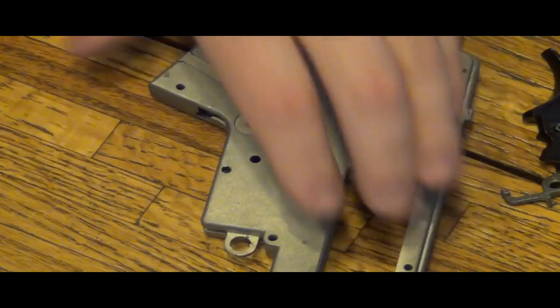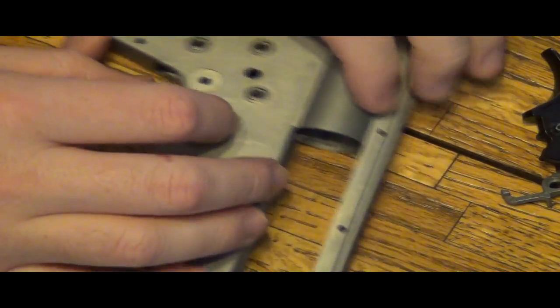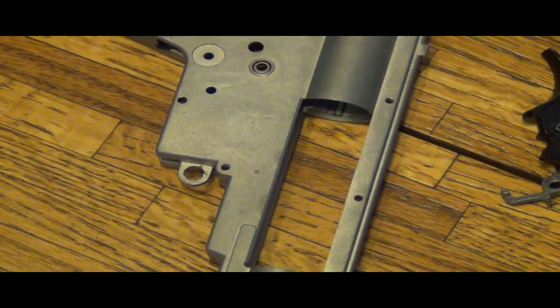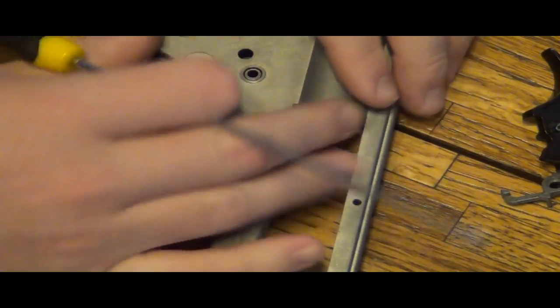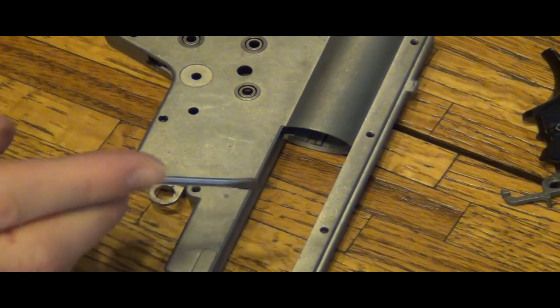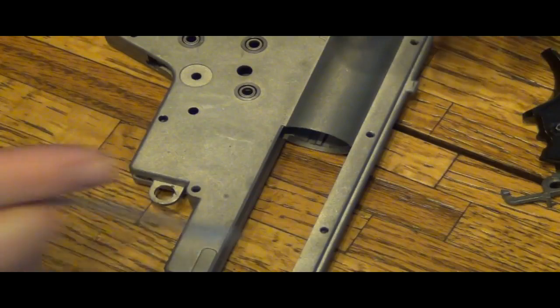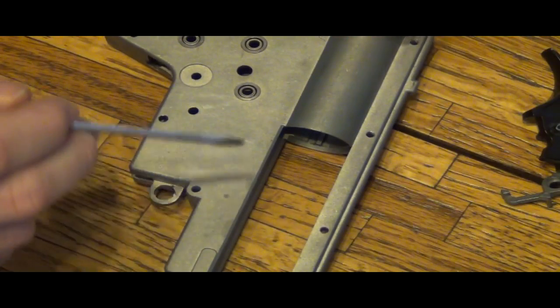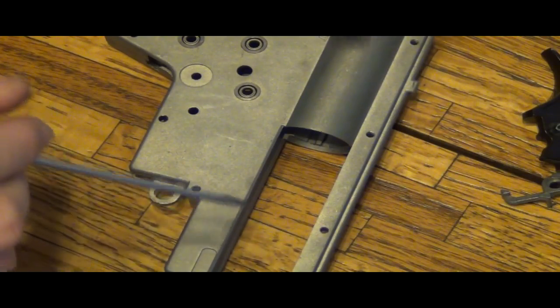When you go check your shimming, always close the gearbox up with screws, tighten it, and check your shimming with your finger. Use a tool, check up and down movement with the gear. And when you spin it, check your resistance. Basically, even with knowing all this, what makes you shim good is you. Okay, it's part experience, but also part skill.